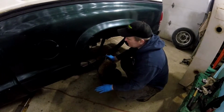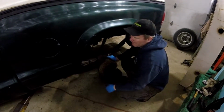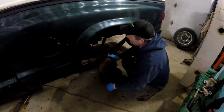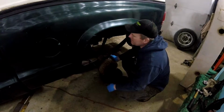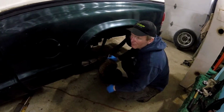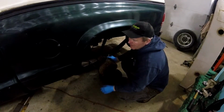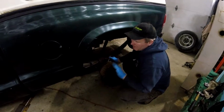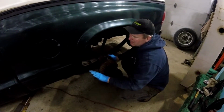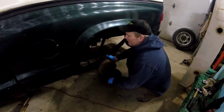Eventually after you do this, sometimes you might have to go around the whole vehicle once to get all the air out. You just do it a couple of times until you see a bit of fluid. When you see a clear flow of fluid with no bubbles, you stop, and eventually his pedal will start coming up where he doesn't hit the floor. And when his pedal is up, you want him to push on it, and you want to open it a little bit and then close it, still with the pedal not touching the floor, so you can just push the air down through the lines.